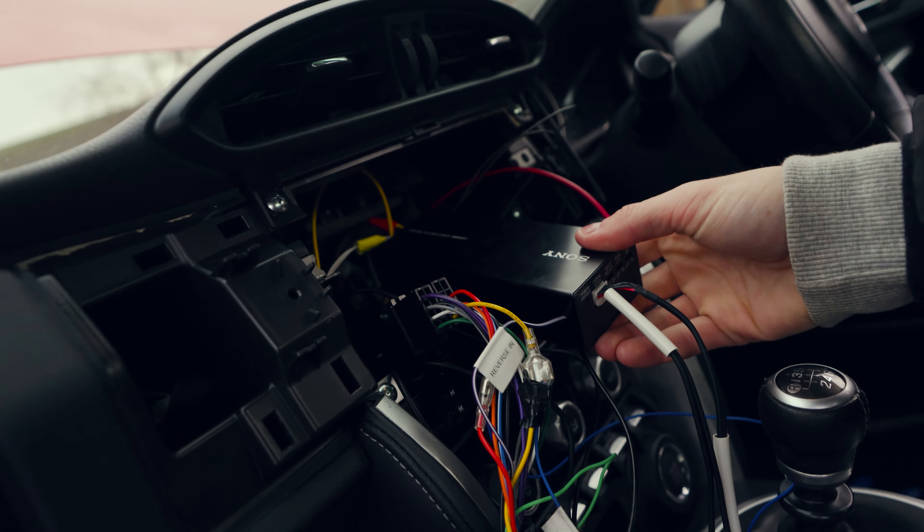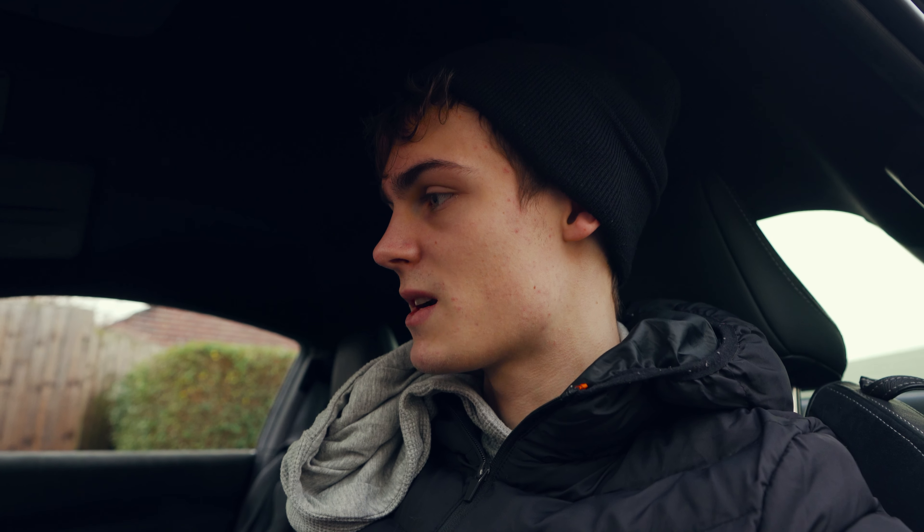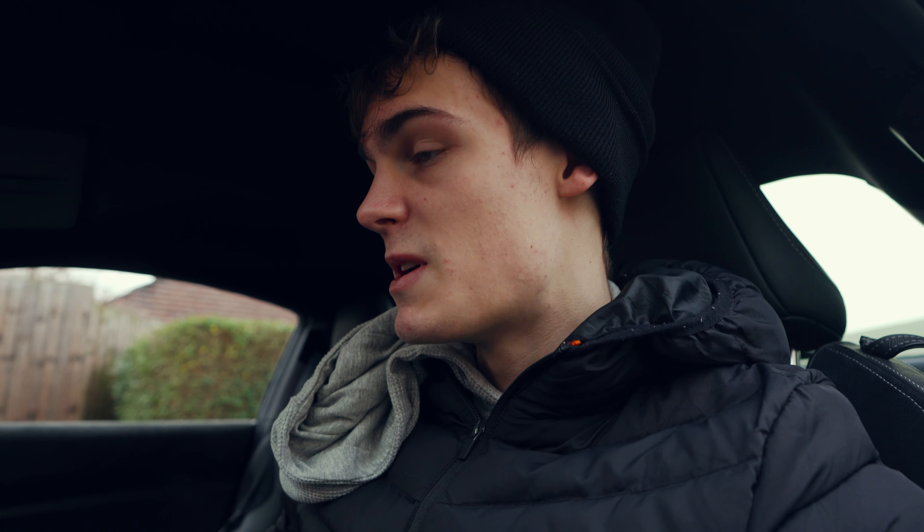I've got the amp, which is this tiny little brick there. I've got that amp all wired up except from the speakers, so I need to get the speakers sorted out. What I'm hoping I can do is put the speakers in and tape the old harness, or the old speakers, just to the side so they aren't being used. Hopefully I'll be able to run the cable for the speakers just through there. The amp turns on with the ignition and everything. I just need to wire the RCAs from the stereo to the amp speakers.